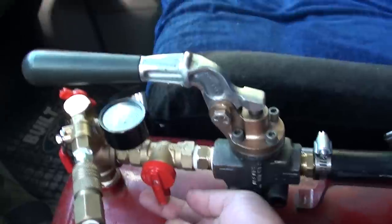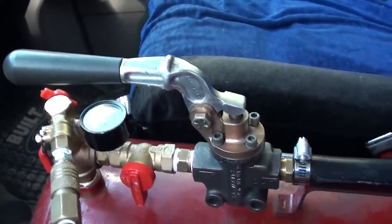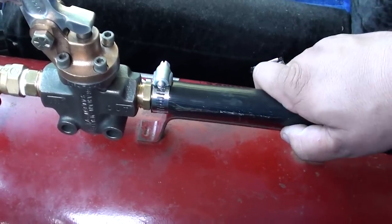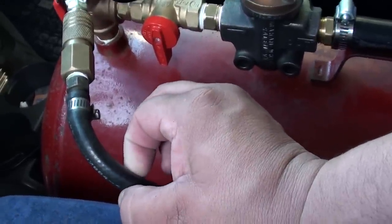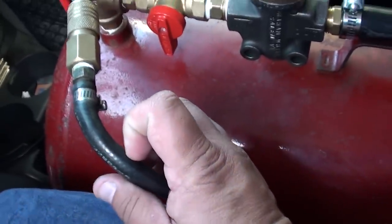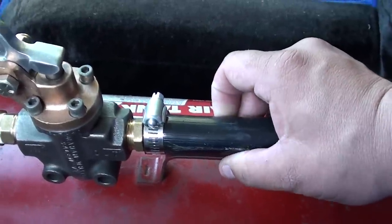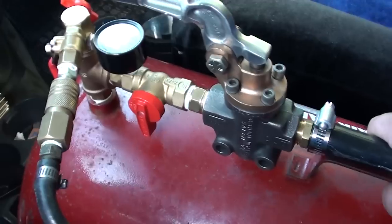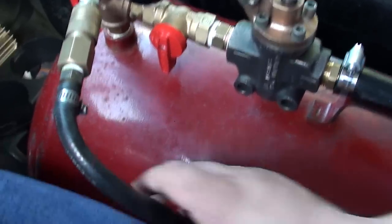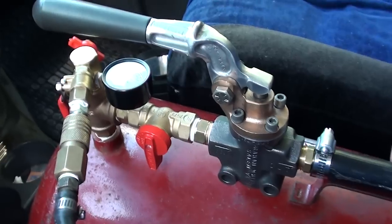I use a quarter-turn gas valve here to power the train horn, and as you can see I'm using a much larger diameter airline. The original airline was 5/8-inch diameter on the external and 3/8-inch on the inside, where this one is 1-inch diameter with 5/8-inch internal diameter. Both hoses are rated for about 200 psi or more — this one is actually rated 300 psi and this one is rated 200 psi according to the manufacturer specifications.